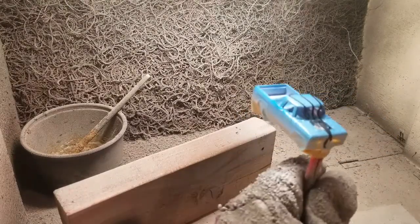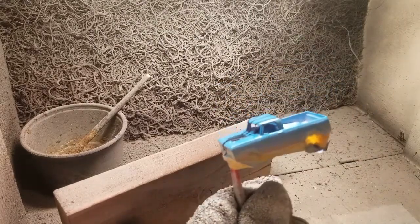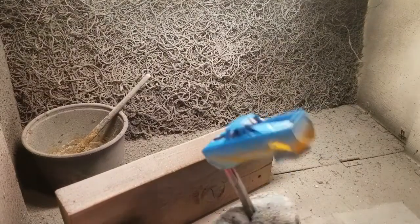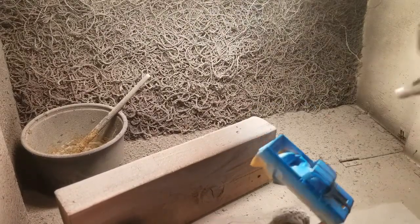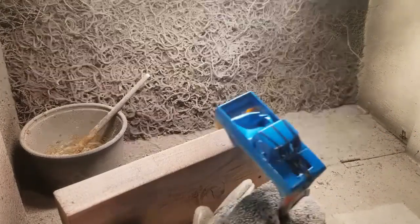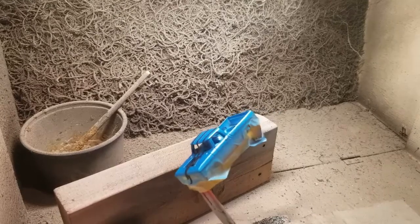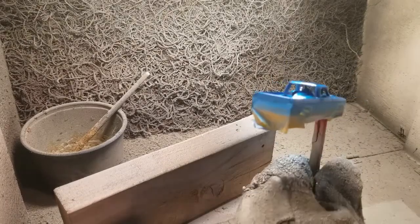Yeah, I did get a little nervous here the first couple coats, like I did with the red, not having a color-keyed base coat, because this is pearl, and I thought I'd be okay by not using color-coded base coats. The main reason I threw the candy in there was to darken it up a little bit. After I kept going, it did seem to really bring the blue out, and it didn't seem to make a difference not having that under there, at least not for this. If I would have, it probably would have been a little bit darker right off the bat. When you see the final, I don't think it made too much of a difference.